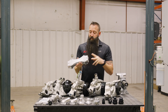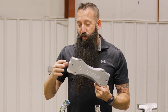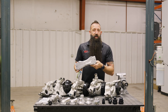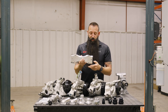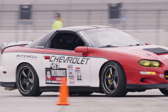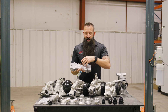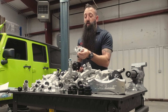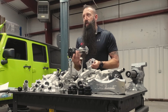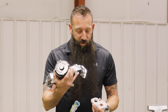The water manifold basically crosses over the two sides of the engine, and you can run both lines out of one side or one out of each side. You only need one per channel — there are two different grooves that run across. You can mix and match or put both on one side. A lot of race car guys are going to use these because they're running an electric water pump not mounted to the engine, so it has less drag. We also have an adapter where you can run a big-block Chevy old-school style water pump.